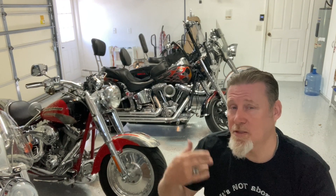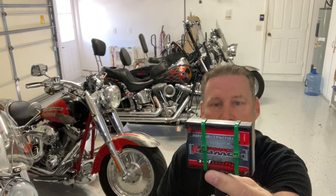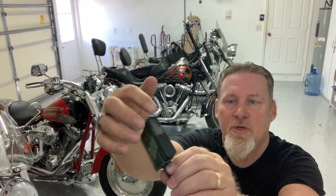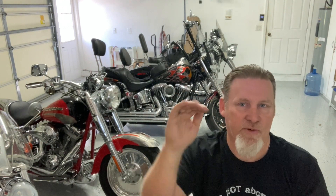There's just not a lot of room underneath those seats for all this extra stuff, and that ended up kind of being part of my problem. So I took it back to them. They said it was not getting enough air and they moved it up on top of my ECM. I was riding and riding and riding, and then I come to find out that I had literally smashed the box. I put it back together using a couple of wire ties, but I actually even broke a chunk out of it right there. So I moved it again, back basically under my passenger seat. There's a little valley, and I put it up in that valley, and it worked good for a couple of years — I got airflow.